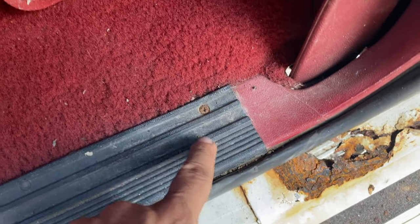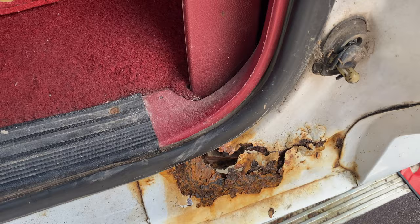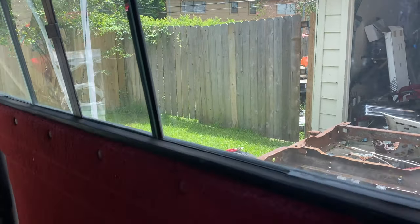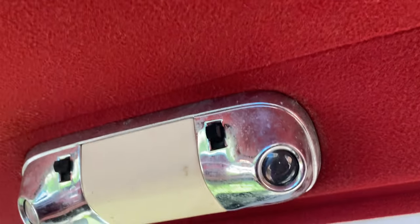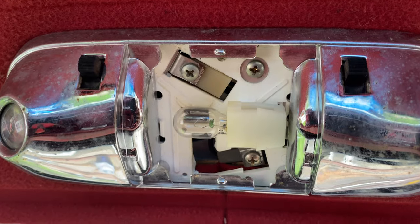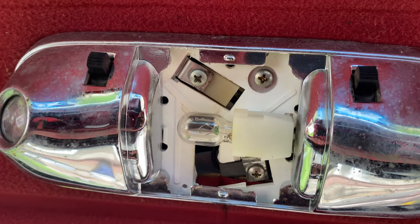The trim panel goes underneath this piece right here, and those are very badly rusted. There's another really bad piece of rust right there in the door jamb. I now have the majority of the trim panels out around the back cabin of the truck. Now we're going to go on to removing this back carpet — it looks like it's just four push pins or fir tree pins, so I'll remove all of those and get the back carpet out. With the rear carpet out, I'm going to move on to removing the headliner. To get the headliner out you have to remove your sun visors — three screws right over here, one screw on the back side of the anchor port on each side. Then we need to come up in here and remove this rear light. Removing that panel shows us about three screws — I'll remove all three and bring this down.